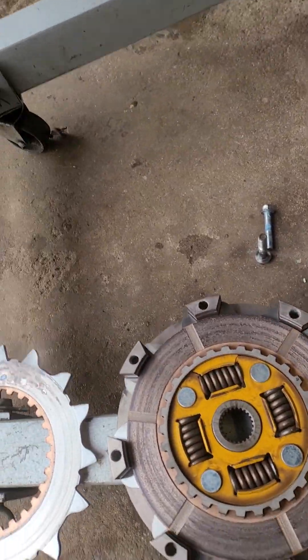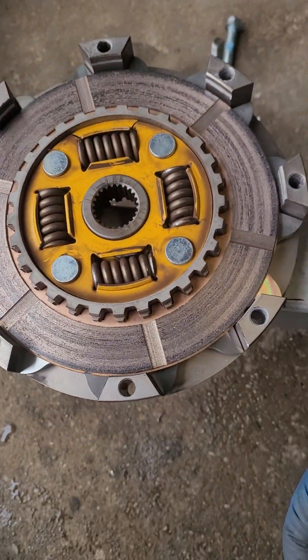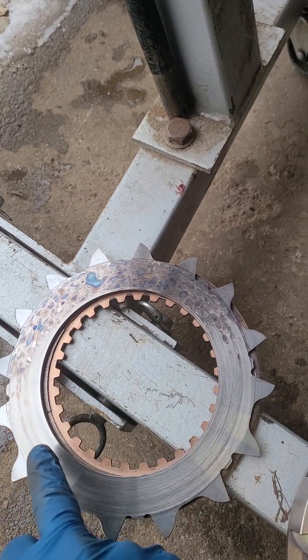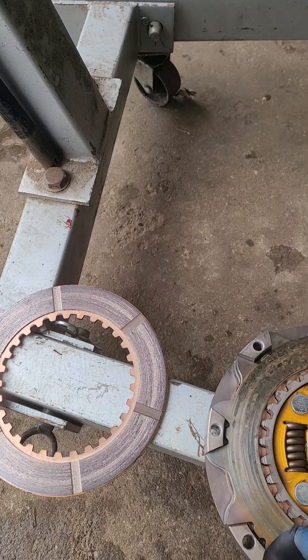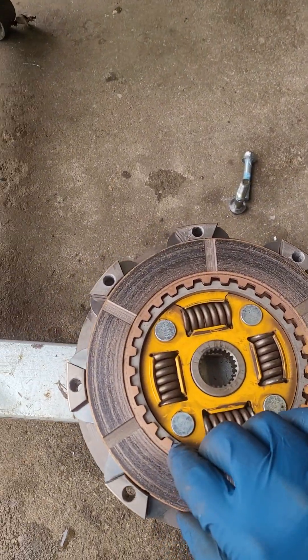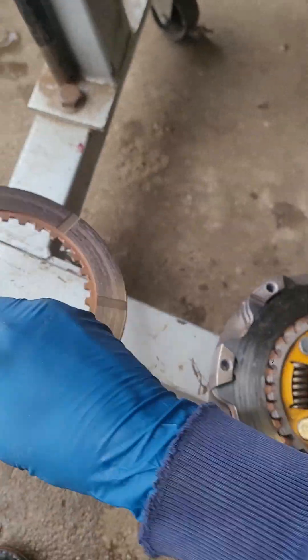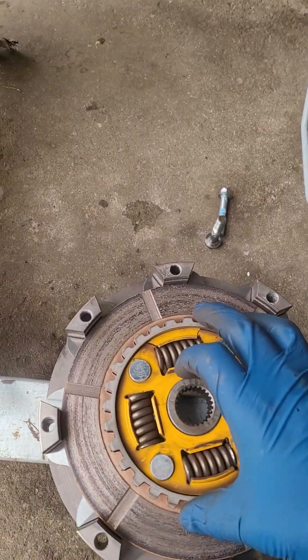So here's the analysis of what happened. The transmission is good — it didn't slip like last time, these gears are good. You can see clearly that it got hot here and not here. It's on there correctly and fits down there correctly. It looks like it's only using half of the clutch.